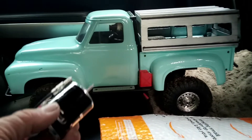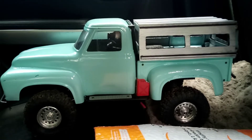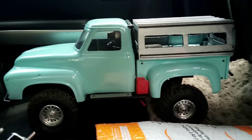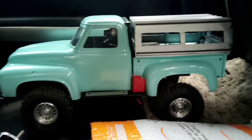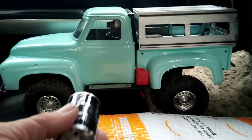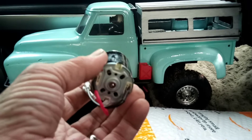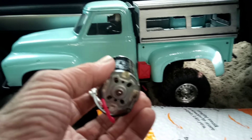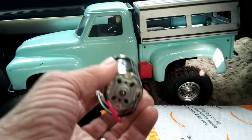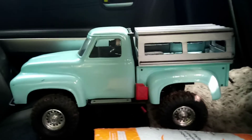In a nutshell, I wanted to try to run two motors in the truck using a Y cable to run two motors off one receiver channel and one ESC, connected along with the throttle so the motor propelling the truck goes forward and the second motor attached goes forward too, driving the winch. I'd have a switch so the second motor is dormant when off, and active when on — going reverse allows me to pull out the cable attached to a pulley on the motor shaft.